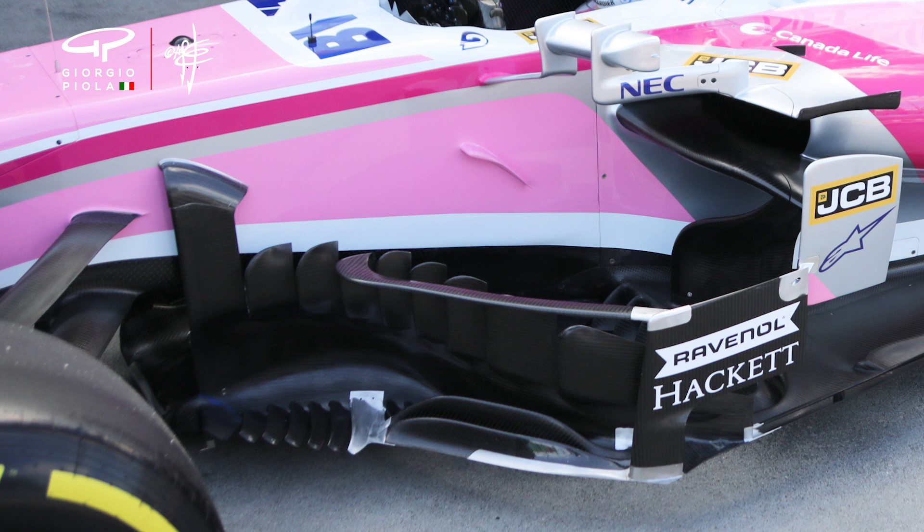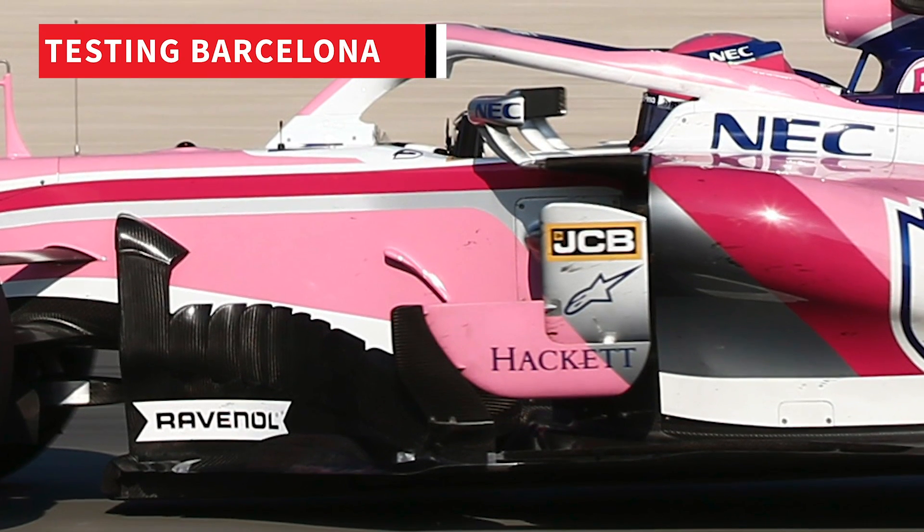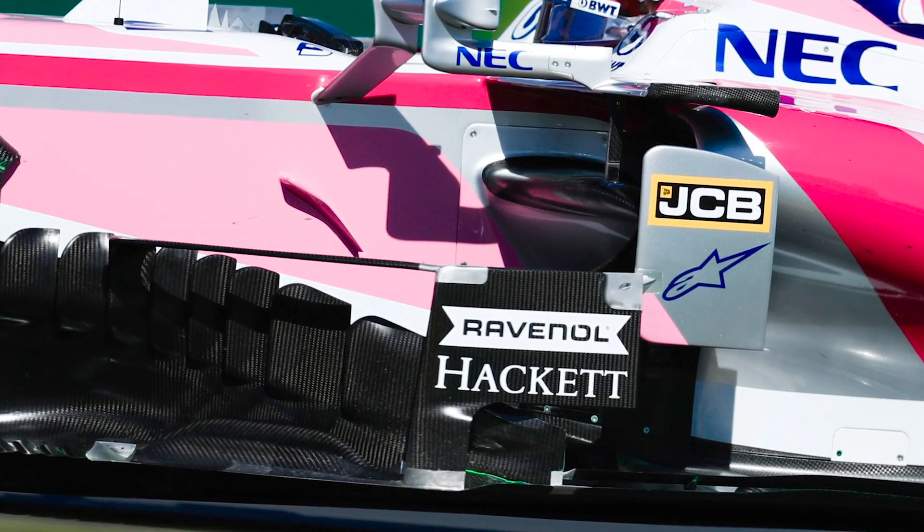That horizontal piece connects to the side pod turning vane, which is very similar to what Red Bull and McLaren have as well. It adds a little bit more dimension and options for taking the wake from the tire and turning it into something usable — directing it around the side pods and trying to protect the floor a little bit, working it a little bit harder. This particular piece here has also changed. They've tried to be a little bit more deliberate and pragmatic, essentially just taking as much tire wake from this massive swirling air that propagates here.